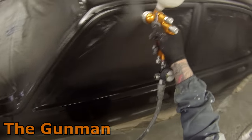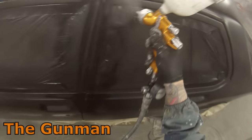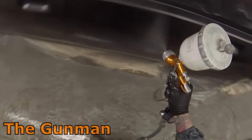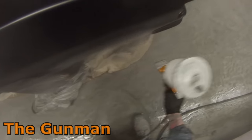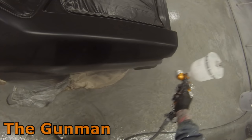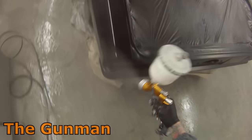It's a bit of a colder day — 17 degrees Celsius — so I've got the pressure up to 20 psi. In the middle of summer I'll sometimes run even under 15 psi. Those air pressure and gun settings will drastically change depending on the air cap you're using. There are a few different choices when you get the Pro Light: TE10, TE20, and HV30. The HV30 is an HVLP air cap that will probably run best at around 2 bar, which is actually a higher pressure than you'd imagine given that HVLP stands for high volume, low pressure. I'm not the biggest fan of HVLP guns so I stick to conventional guns these days.